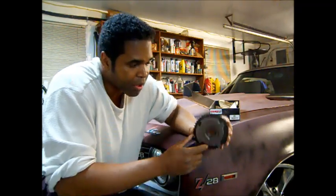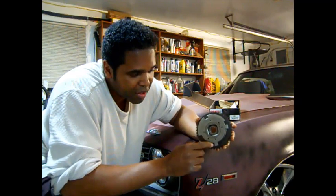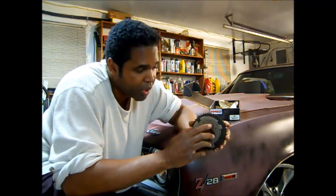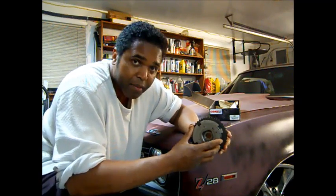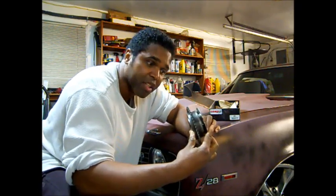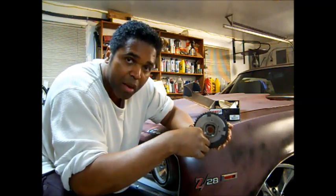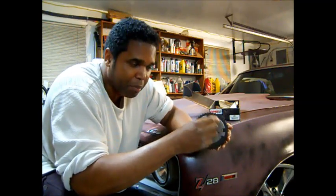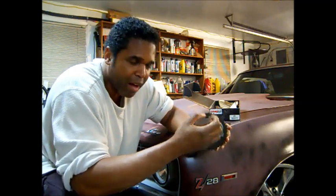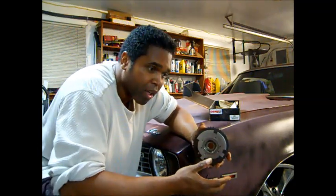Now, if you've got a 6.0 cam sprocket, you see these little designs right here? This is what the cam sensor reads. The regular cam sprocket on the LS engine is nowhere near as thick as this — it's a fraction of what this is. They'll have the same cutout, but it'll be kind of beveled out. That's why it reads the cam sprocket, and that's why you've got to change your timing cover.